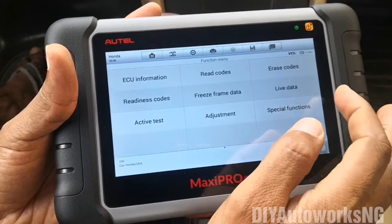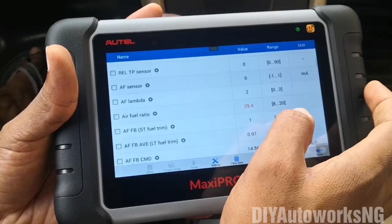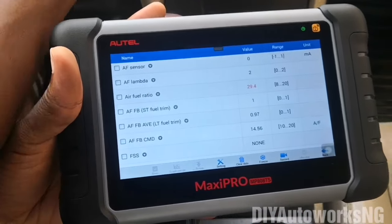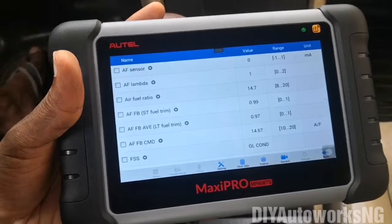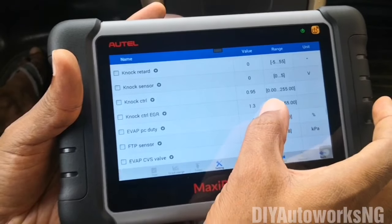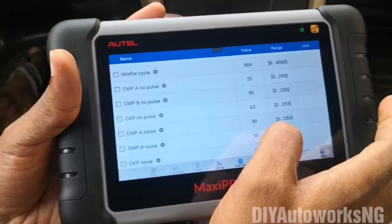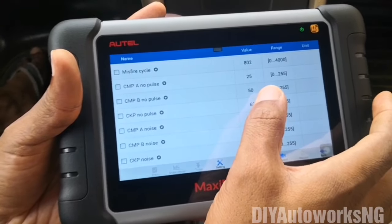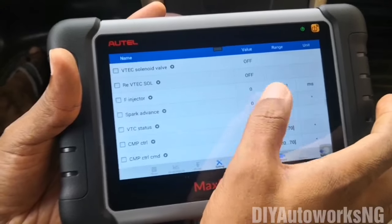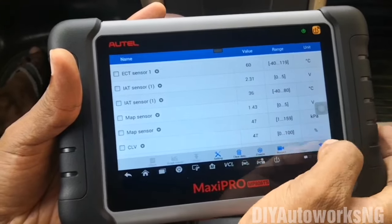Let's do engine. So that's what it's able to do in terms of the engine ECU — it has access to live data as you would have in other scanners. You're able to see all of the live data: fuel trim, fuel trim ratio at 29 — let me start it — it goes to 14.7, which is what it should be. And it has misfire monitors, solenoid valves, and so on and so forth.